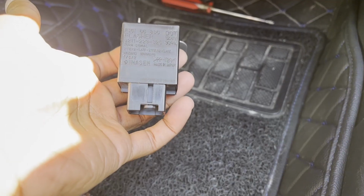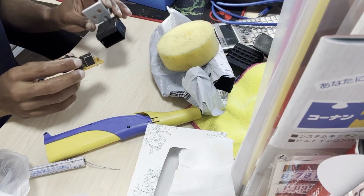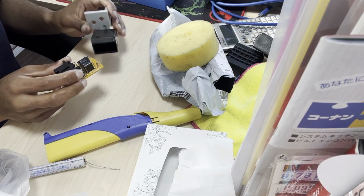This over here is the bonnet or hood release cable, and that's attached to the hood release latch. Directly above it, there's that crosshead screw. You're going to have to undo that screw, and once you undo that one screw, you should be able to remove this metal bracket, which has the indicator relay attached to it. And there we go. That's the indicator relay. It says flasher on it. Here we have the indicator relay that we just pulled out.